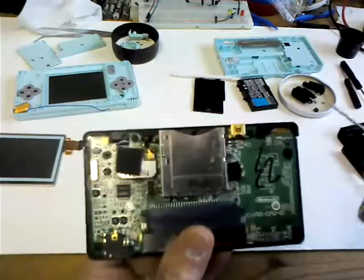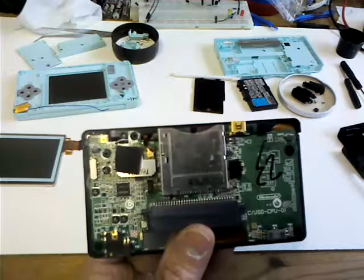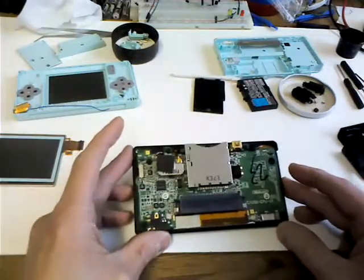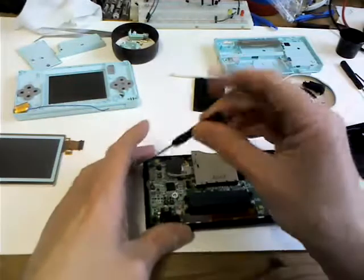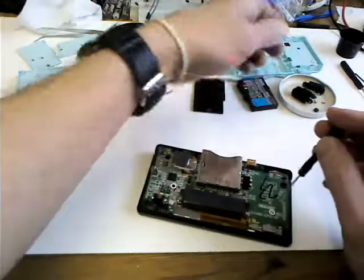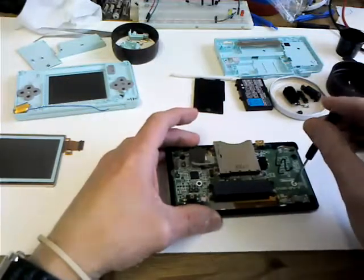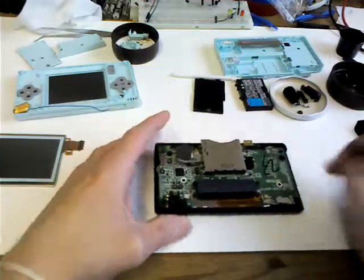The tiny fuse for charging is up here. I could take it off the other board, but I think I'll just wait for the replacement to come, because I want to try and fix that other board as well. So there's the charging fuse which is blown in mine, and the other fuse is down here from the battery area. There are two little Phillips head screws, one there and one there - you can see them with a white ring around them. I usually put these smaller ones in a different tray because I don't want to mix them up.